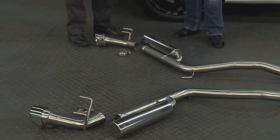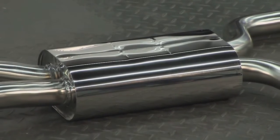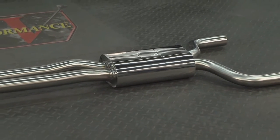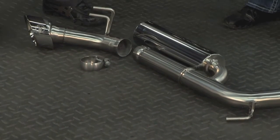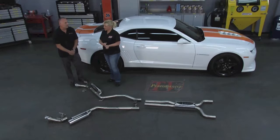Two and a half inch, 304 stainless, all the way through. Yes, the system is designed to bolt up to the original catalytic converters. The front unit is a sound absorbing mixing chamber. It's two and a half inch, all 304 stainless with a lifetime warranty. It goes into the mid pipes so that you go through the axle area and come out to the tips. We put in our Helmholtz sound canceling chambers to reduce the drone, so when you're out on the road and cruising,